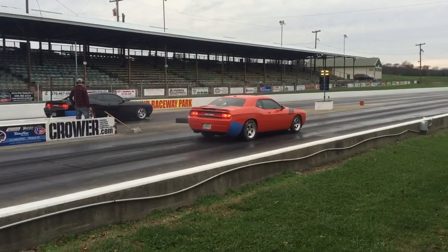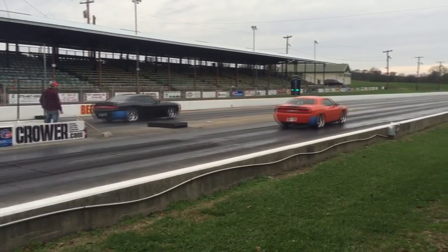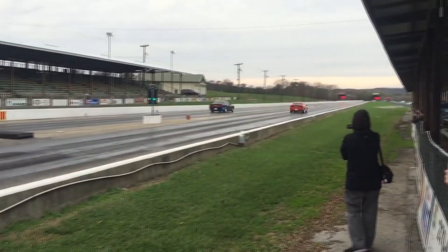Now when I went to the track as we started trying to get the car to go faster and faster, Mike did write me a race gas tune. Now unleaded 109 octane is what I like to use. I use a Renegade brand race fuel that's easy to get here locally and with that fuel in Orange Crush I was able to get that manual transmission six-speed car to run in the 10.80s and it would do it consistently.